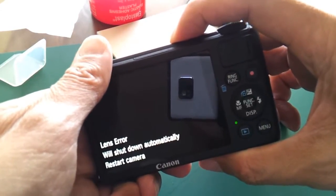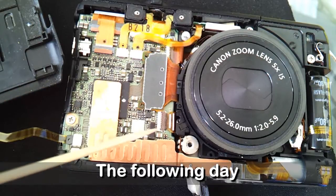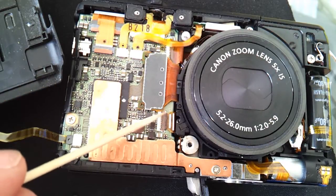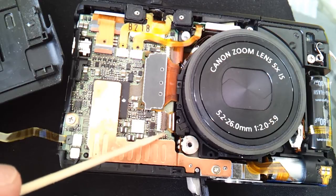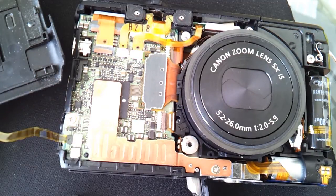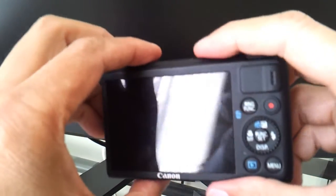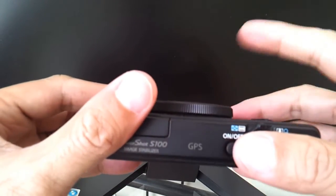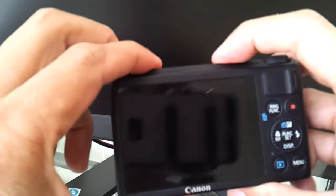Okay, it didn't help — maybe I will try something else. I just realized that the connector here — I didn't put the cable correctly. Now I've put it back in the right position and I think it's working now. The lens barrel just retracted. I realize the cable wasn't connected correctly and it made the camera go crazy with the lens barrel going in and out. Now I've put it back in its correct position and hope it will work.